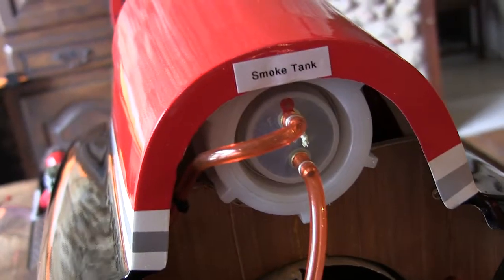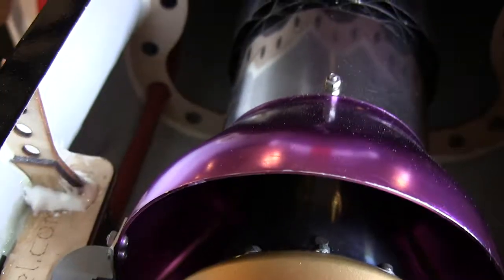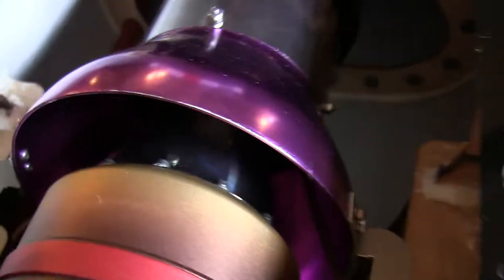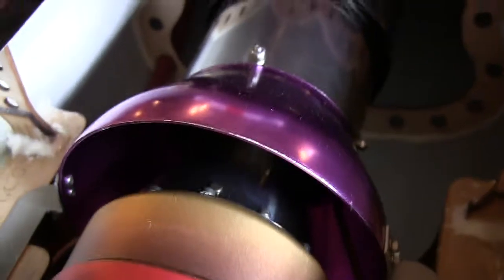So this is an advice to anyone who considers that sometimes you have to wait, instead of consuming part of the fuel. On the top of the tanks from the back, I've added here a special tank dedicated for smoke connected to the pump I've shown you. This is the smoke pump, very easy, goes from here, from the tank, till inside the inlet. So you will see here from the inlet, I have 2 connections. One is here, it's a copper one, and the other one, the copper, you can see it inside. Both are going straight into the tailpipe, around 10 centimeters after the output of the turbine, so it will spread the smoke oil into the flue and you will have fantastic smoke.